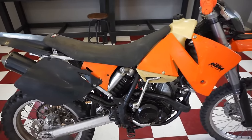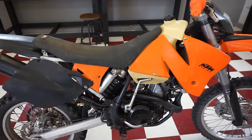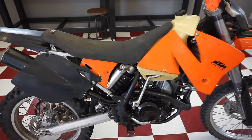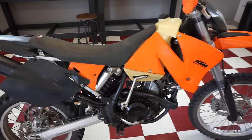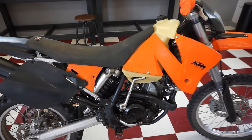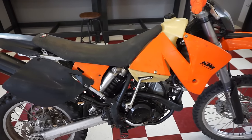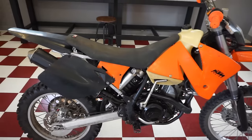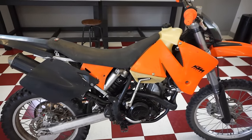And that's why the battery wore out, because the guy kept on trying to crank it over and it was just having too much compression to turn it over, which just drained the battery. That's kind of my assumption, because the oil looked good, everything else looked good on this thing. So I don't think it was a problem with the one-way bearing. But we have one just in case something goes wrong, we can always replace it. But for now, I think we're gonna keep it like that because we haven't had one single issue with it.